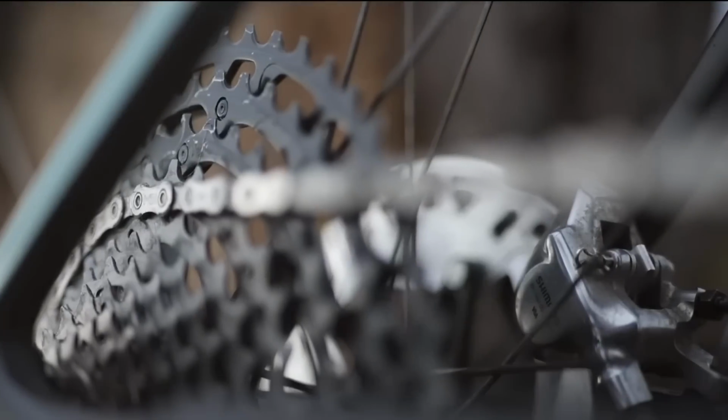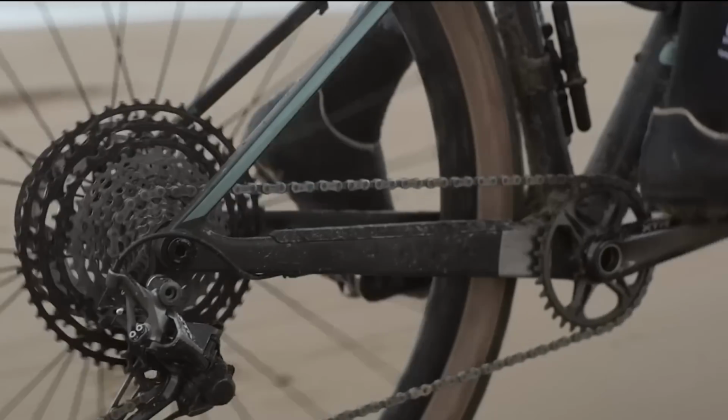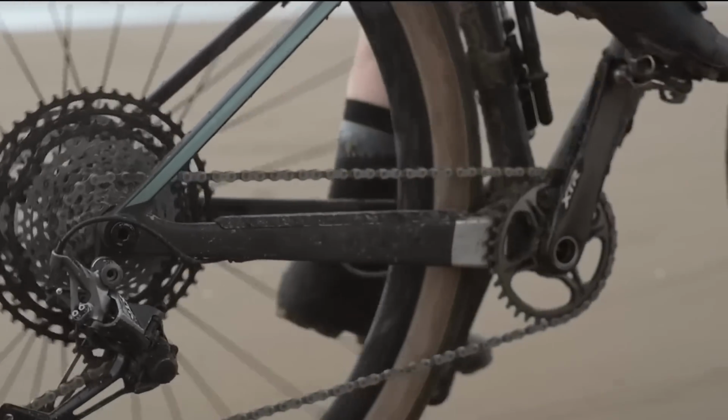And so you not only have incredible tolerance and size control in the chain, but you also have to have very controlled gaps in the chain, which is why if you take the chain and put it on its side, it will actually take on a slight arc, and that's the stack up of all of those little high precision gaps. But then, of course, the chain isn't sealed like a bearing, and so we now need to lubricate it, and now that lubricant has to perform in a completely unsealed, exposed environment.